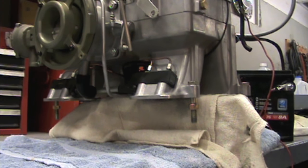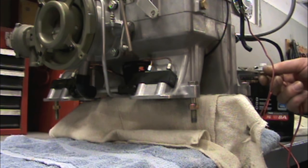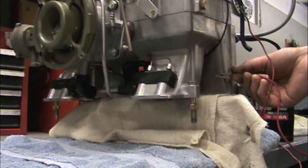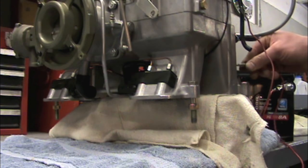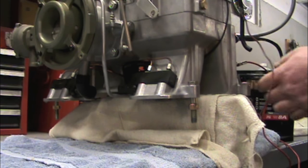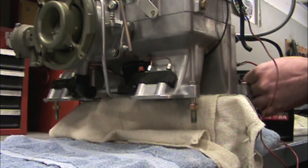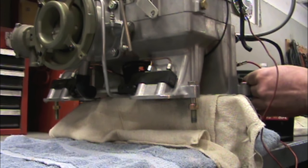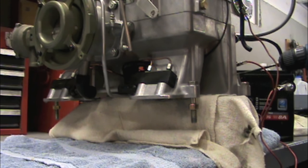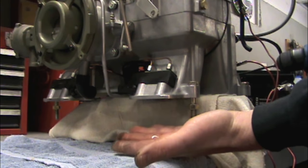The last step is to check and make sure we don't have any leaks and make sure the valve's working. I've just got it temporarily wired up to a battery — this is controlling the ground side, and you should be able to just ground the housing and hear it click. So you ground it, then take your drill with the fuel pump drive rod, fill the fuel meter up with fuel, apply vacuum to the main control diaphragm, and you should see some fuel squirting.